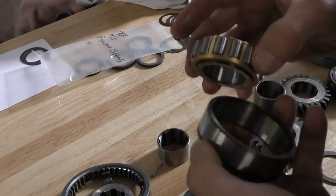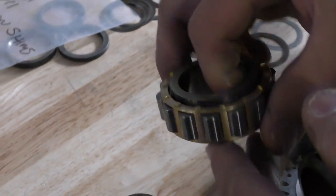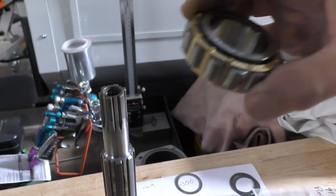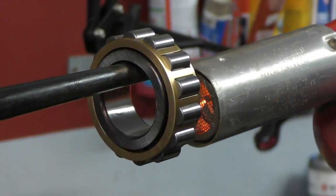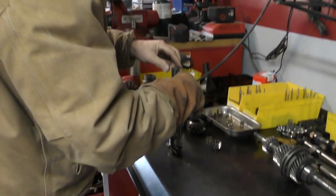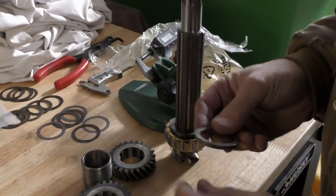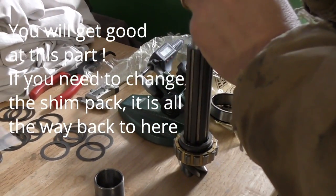On this particular cage — same as on our input shaft — one side is perfectly smooth and the other side has a brass ring that's been peened on. That brass peened ring needs to face the gear sets. Just like I did on the input shaft, I'm going to heat this bearing so I can drop it on, and then we'll set up with our shim pack and start assembling our pinion shaft. My shim pack is going to go in first, followed by my spacer ring, and then the same as the input shaft we want to assemble all of these gears dry.